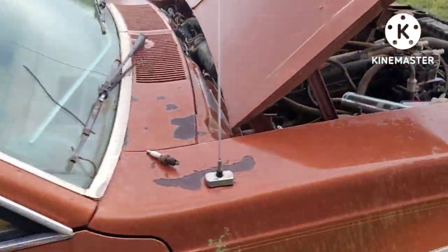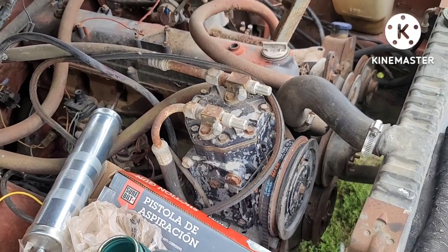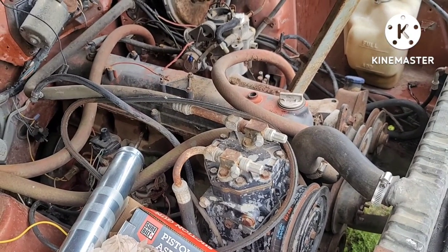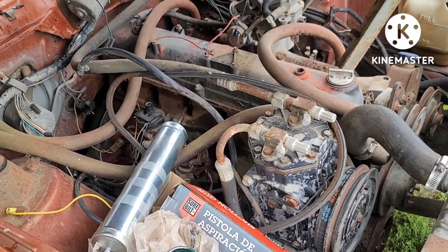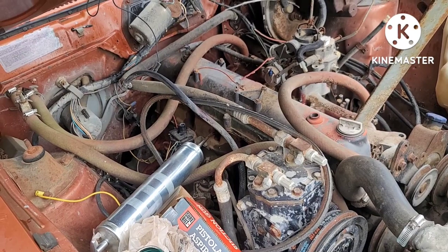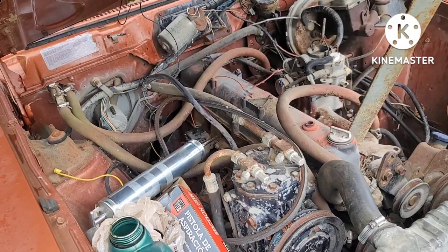He's kind of got an idea here to take a little plate of steel and cut three holes in it and maybe weld a socket to it, or cut a square hole in it and try and make a little plate to bolt to the balancer to get her a little more leverage without breaking a crank bolt or whatever. So we'll see how that shakes out when it does. I've never personally attempted anything like that myself. Really never worked on a stuck motor, frozen engine any time. So this is a bit of a first trial of discovery for both Aaron and me.